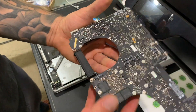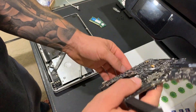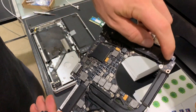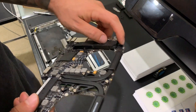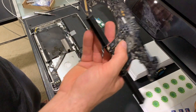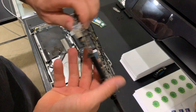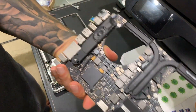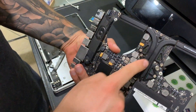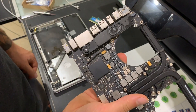Once you remove all the screws that hold it in, you'll see all your connections. Slide it out on an angle so the connections can clear the case. There's also one hidden connection on the back — make sure you unplug that one, because when you lift it out, it'll still be stuck on there. Nine times out of ten when you send this off, you'll also have to take off your speaker and your heat sinks. There's really not much more left and then we can send this off.